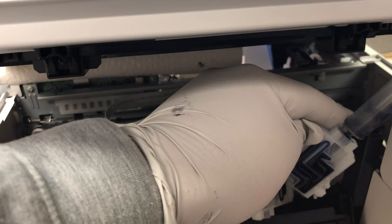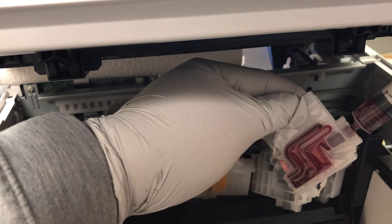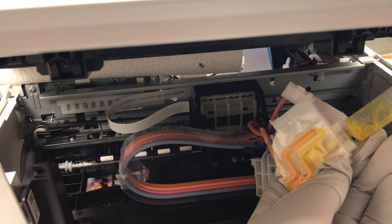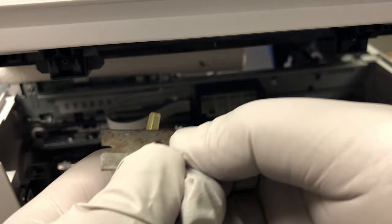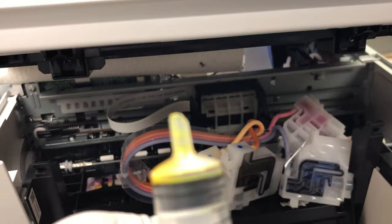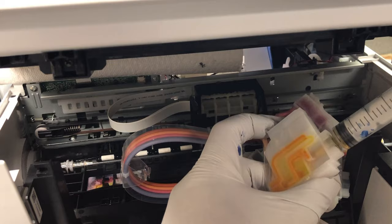You can see I almost get a vacuum inside the syringe. Normally I should feel really smooth ink flow into the syringe. Same as magenta — when I pull, I almost get 10 ml of vacuum. Same as yellow. I work on the yellow first because it's easy to see. Just make sure the problem is not the syringe we used — I'll take a razor blade and cut it at an angle. You can see it's really, really hard to suck any ink out of the damper.